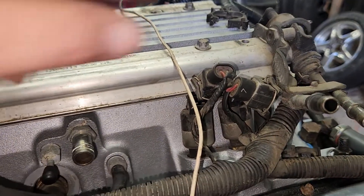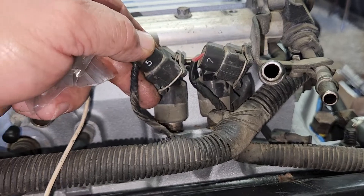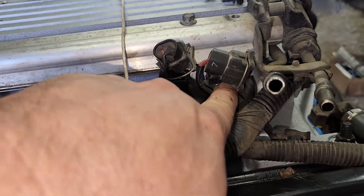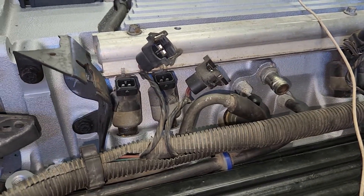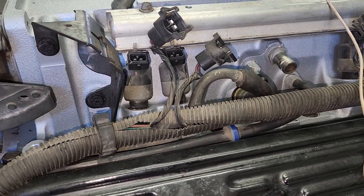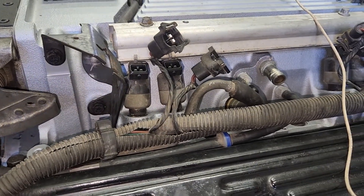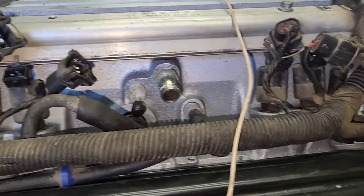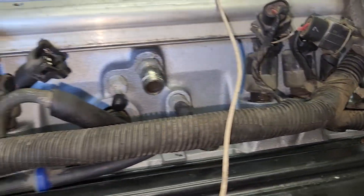Come up here - same thing. We've got the injectors: seven, five, and then three and one. So it goes one, three, five, seven. I'm not hooking those up just yet, and the reason for that is I'm going to crank the motor over and I don't want fuel spraying in the motor - that's how I'm going to prime it. Because I probably should have primed it before I even put the intake on. But the motor is really well lubed with engine lubricant.